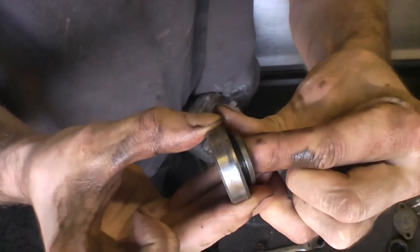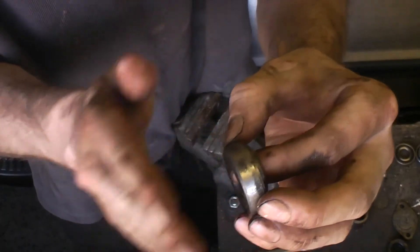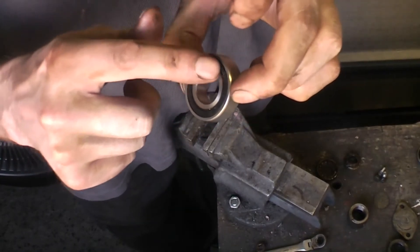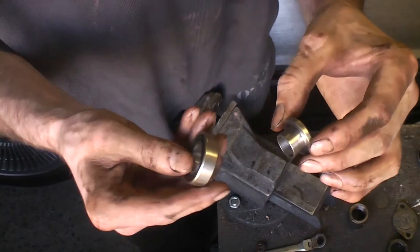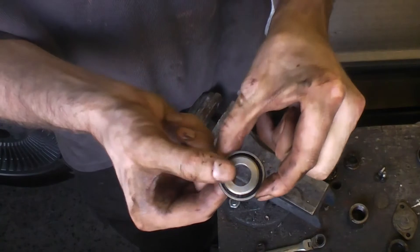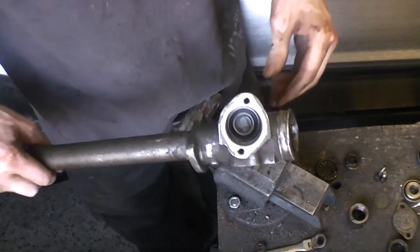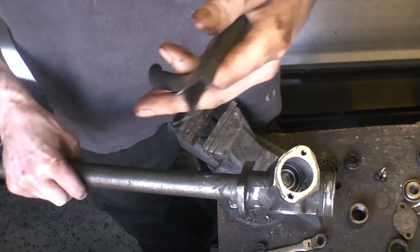The original Lotus pinion assembly has the inner race sitting proud on one side, and crucially, because it's up against a flat face, nothing can protrude out of that side. So what I had done was get forty millimetre outside diameter bearings and have the inside face machined down just a whisker — about a tenth of a millimetre — just to give me some clearance. I also had a little insert made to bring the inner race to the correct depth and give me the three-eighths diameter I need. The outer race came out surprisingly easily using some long pointy circlip pliers — about ten seconds.